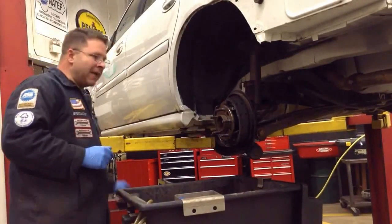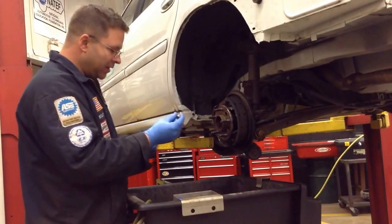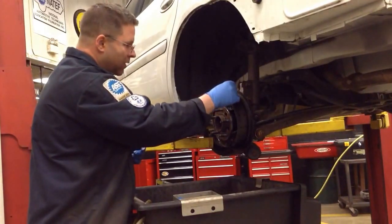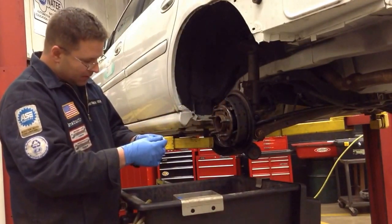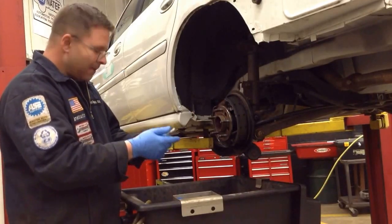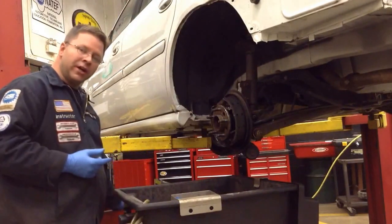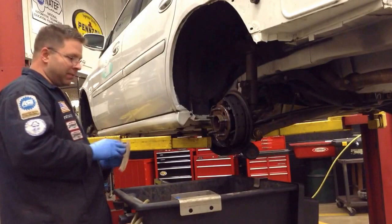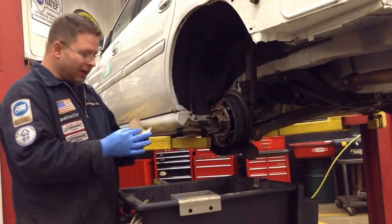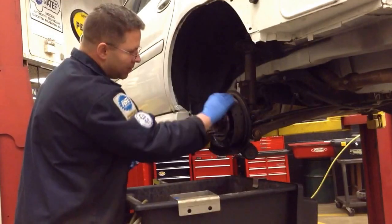We'll take a little examination of the brake lining. We know that these are good. We can use our tread depth gauge — just like checking a tire — put that in there and measure how much brake material is left. On this one we've got about 8/32nds of an inch, which looks really good. We know that at 2/32nds of an inch you're ready for brake replacement. I'll go ahead and take a little bit of that sandpaper and just scuff the shoes up a little bit.